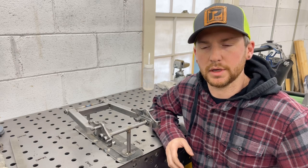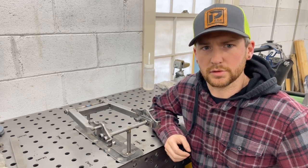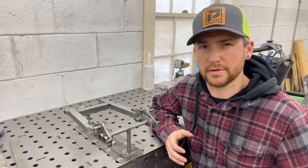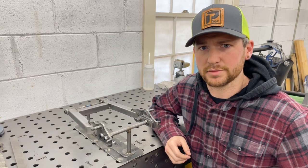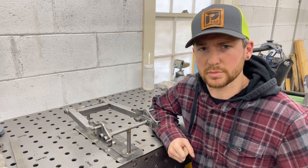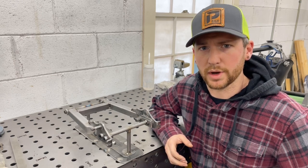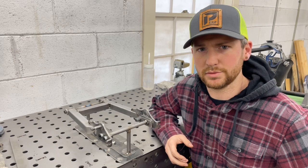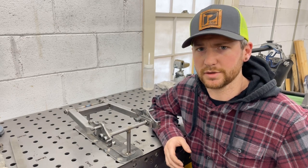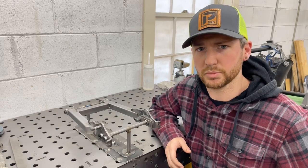than MIG welding. When it comes to Chromoly, one thing that you want to take into consideration is you want to have about an amp to an amp and a half per thousandth of wall thickness as a good place to start. You never really want to see gray in your weld. If you do, that means you got it a little too hot in that area, and you definitely don't want to do that consistently all the way across the joint because it could make it really brittle.